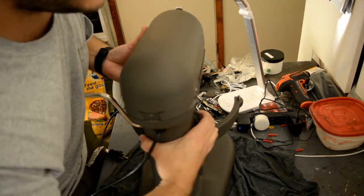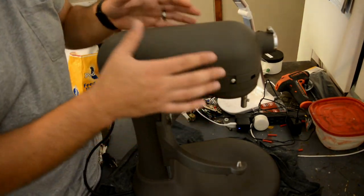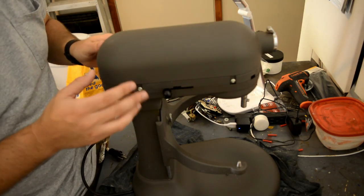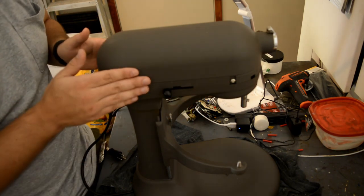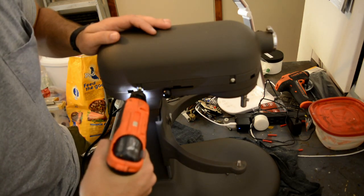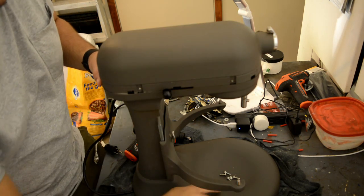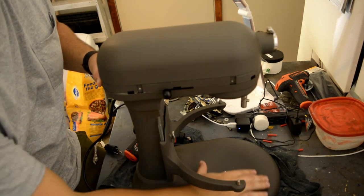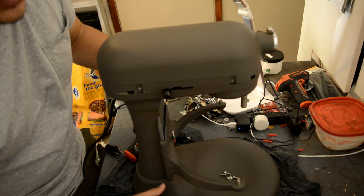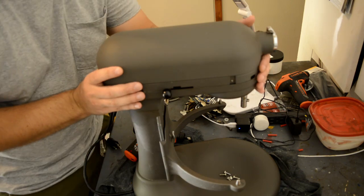The next thing we're going to do is remove these screws on the side to remove the upper housing. This whole top half is called the upper housing. There are four screws — one here, one here, and they're going to be the same on each side. Now that we have all the screws removed, I placed them at the bottom where the bowl kind of sits — it's just a good concave area to keep everything in line. At the end we'll wipe that down anyway, so if there's any dirt, grease, or debris, it'll get cleaned up.